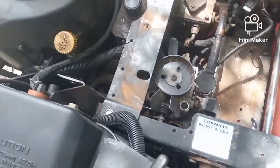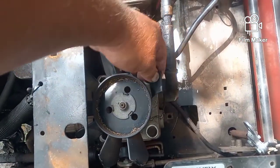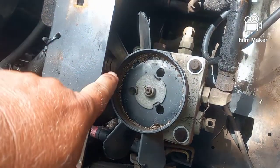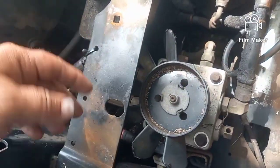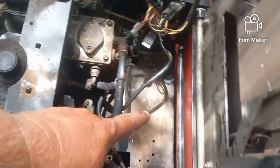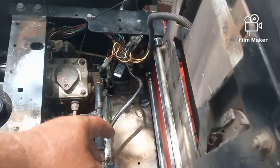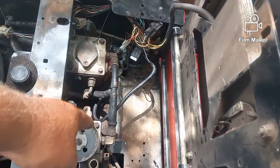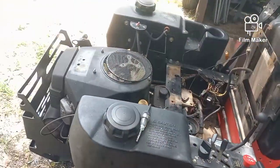The second thing — the weird noise — I found out what that was. This fan blade on top of the drive pump is missing blades. As you can see, one's broken, and in fact four blades have broken off completely. They were hitting something; the ends are a little chewed up. One was flopping around — I just pulled it off — and it was making a high-pitched flicking sound. That mixed with the oil squirting out the side was pretty scary.